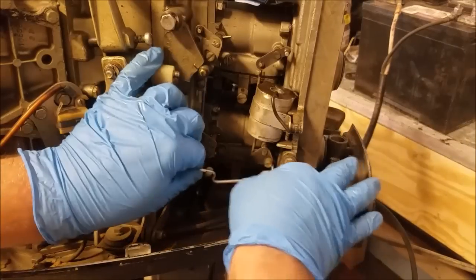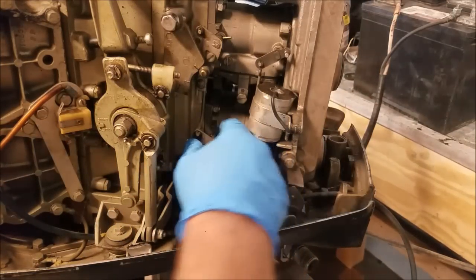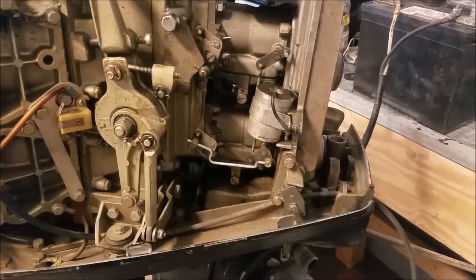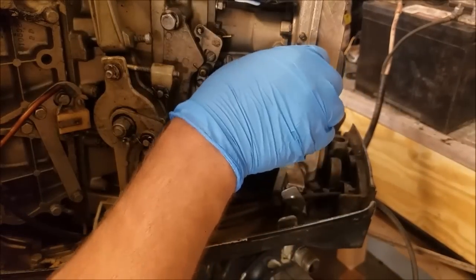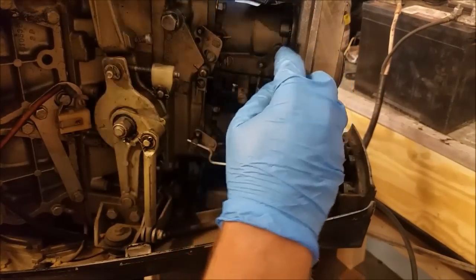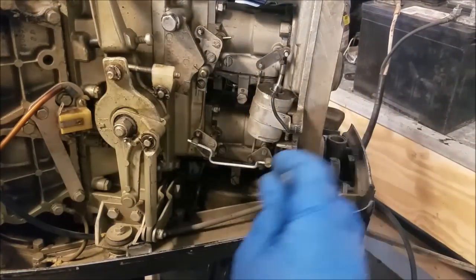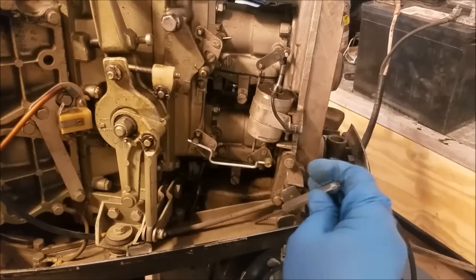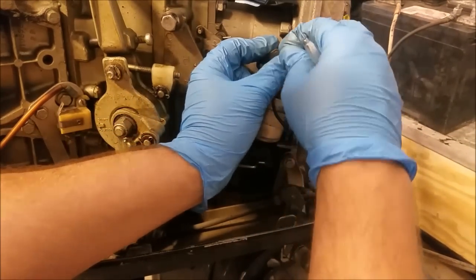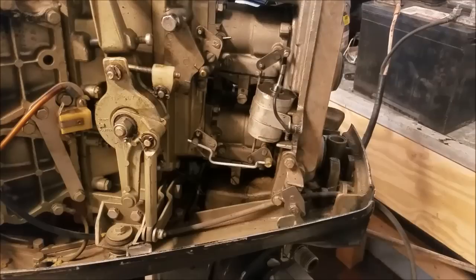Alright, let's reinstall. It's kind of working better already. Now for our plunger — there's a little tiny groove there, and that little groove's got to be lined up. That's better. Now trying to get the little o-ring on. Perfect.